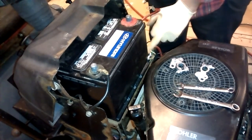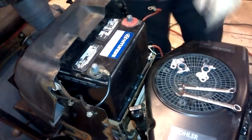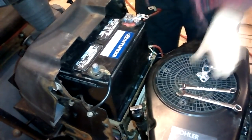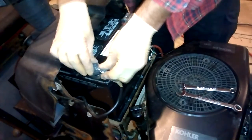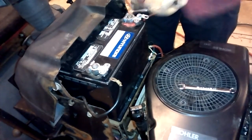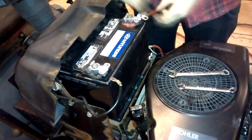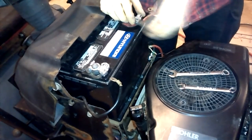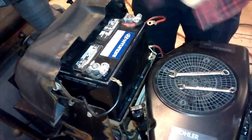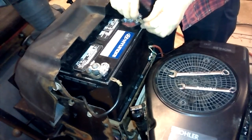As you can see, it does clear this side and this side. I'm up pretty close against the solenoid, but I've got room. It sits in there nice and flat — it's not going to wiggle around, it's not going to come flying out. So now you're going to take your automotive style terminals, go ahead and install those. Use a 13 or half inch to tighten that. You're going to loosen one of your 11 millimeters and remove the other one completely, then sandwich it in between and tighten it back down.